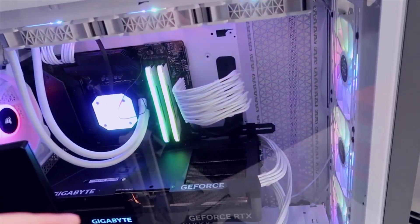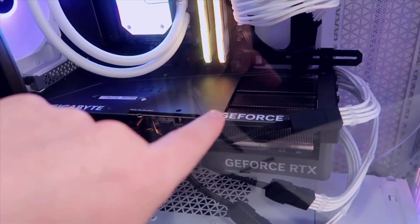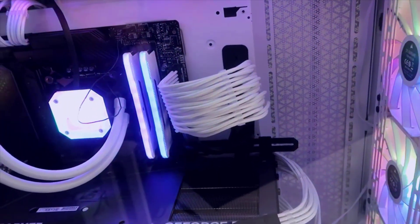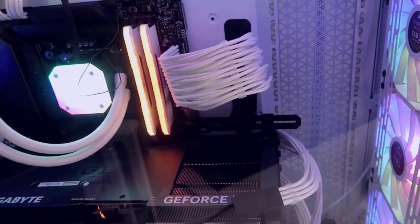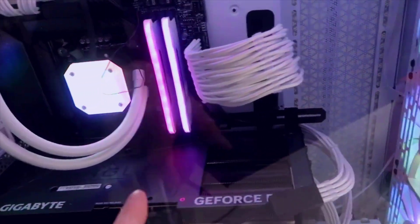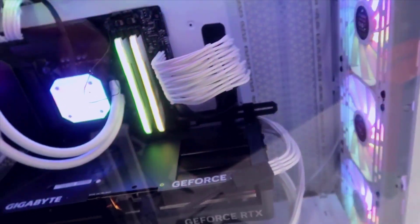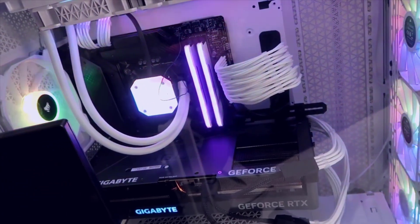This actually comes with a special bracket adapter. There are two bolts that utilize the existing motherboard bolts - if you look at the top right corner here, that's where one of the corners is. You put a standard screw into another piece that goes into the base of the actual backplate of the case. I was able to utilize those existing two pins and this bracket sits within those and attaches to the video card itself - basically preventing video card sag.